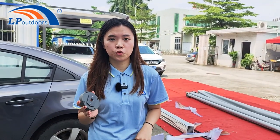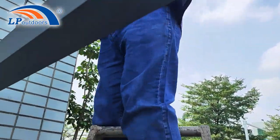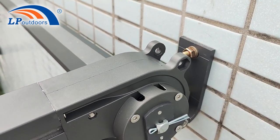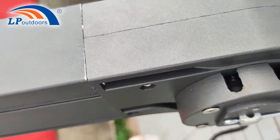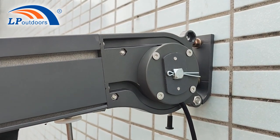After insertion of the tail, we need to use this cap to cover the suction, and this kind of cap to cover the motor side. You can see there are three holes on the cap. Put one hole downward — this one hole is for the electric wire. Put the two holes upward for the adjustment switch. Then fix the cap with the screw, and put the steel wire through the four-hole screw, and open it at an angle to make it stable.